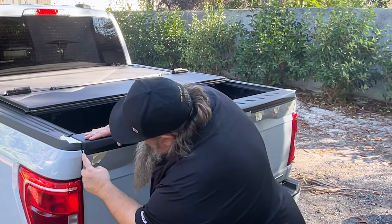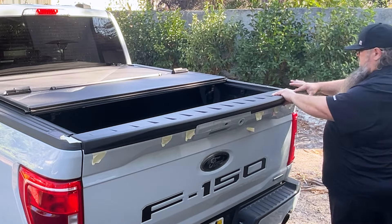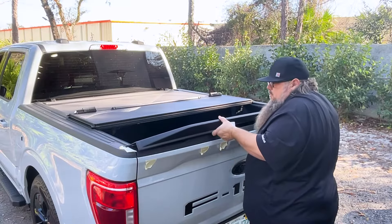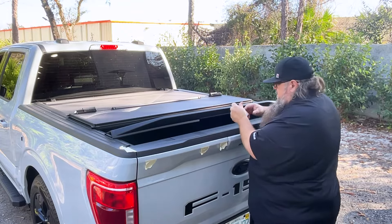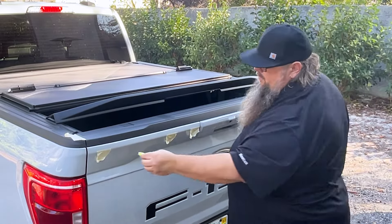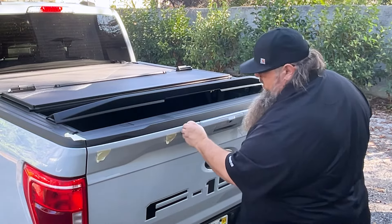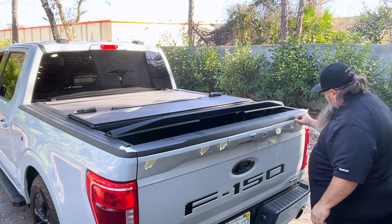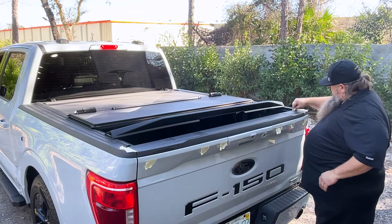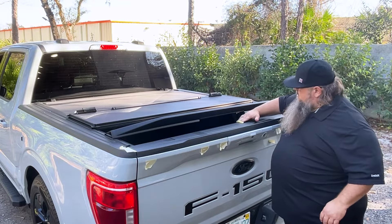Afterwards, just check — you'll have about an eighth to 3/16ths on your side. That looks pretty good. So the next step: remove the spoiler and apply the adhesion promoter. Now we're going to go over that same surface area that you cleaned originally with the alcohol. Remember, the tape is going to go on this painted surface on the back and then along all of the edges of the factory spoiler. You do not have to remove the factory spoiler — that's going to stay in place.